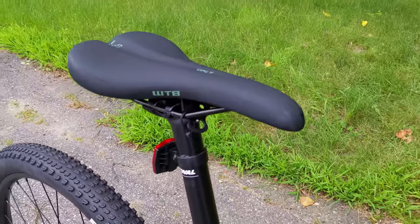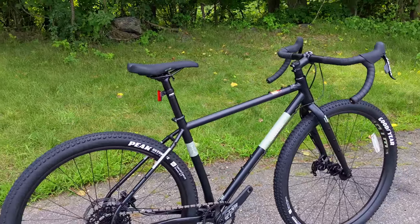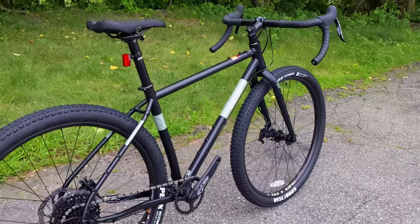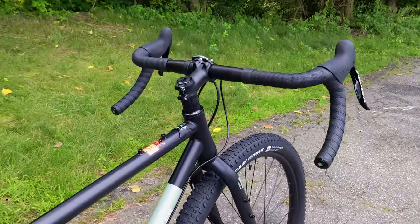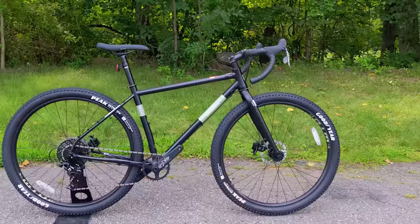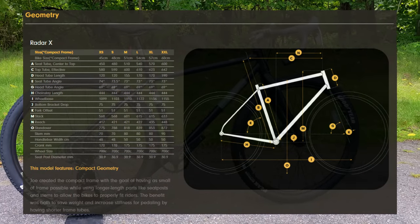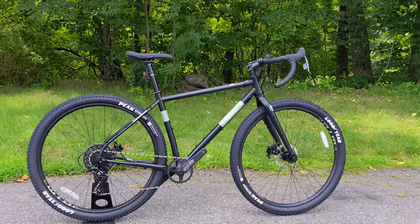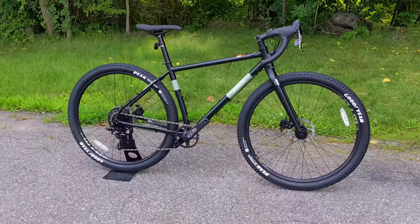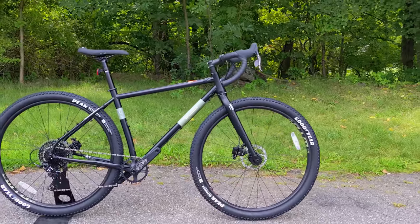The saddle is a WTB Volt. As mentioned, this bike is dropper post compatible, which is pretty neat. Mate that with those mountain bike wheels and tires and it almost makes you think it's a mountain bike. Check out the geometry and you might lean further that way — it's running a 69-degree head tube angle and a 73-degree seat tube angle, which makes the head tube and seat tube basically the same as a Trek Marlin. So is this a mountain bike? A gravel bike? A road bike? I really don't know, and that's kind of what I think is the best thing about it.